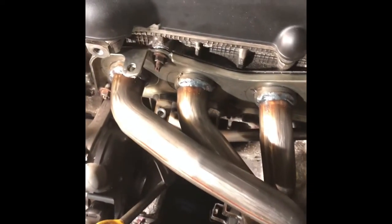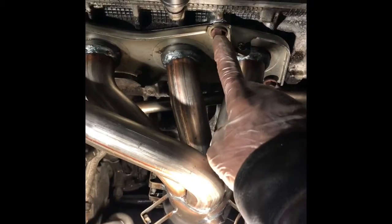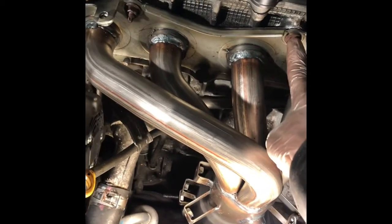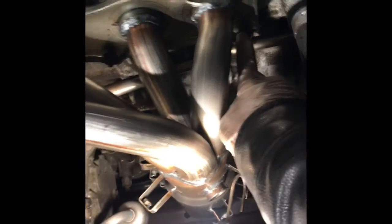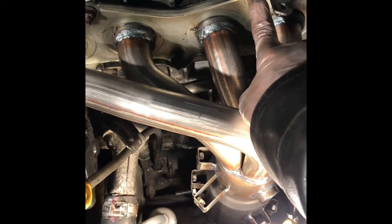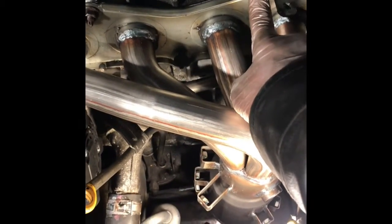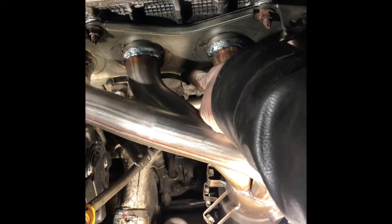When you tie it up, let's go in order. First, just hand-tighten the bolts — this one, this one, hand-tighten. After that, this one and the corner one, then the others. First hand-tighten all, then tighten by order. Don't overtighten like crazy — this is the engine block and it's soft. There's a gasket, so just feel it until it's tight. Tighten in a cross pattern — this one, that one, that one, this one, then the corner one.